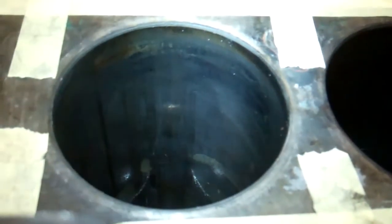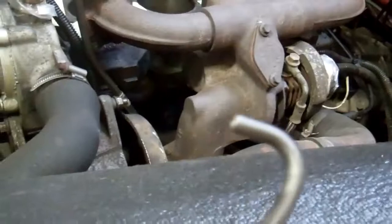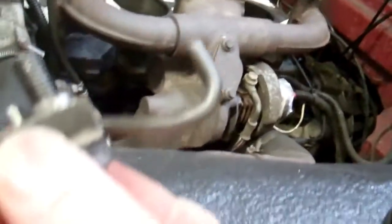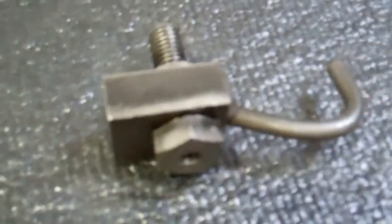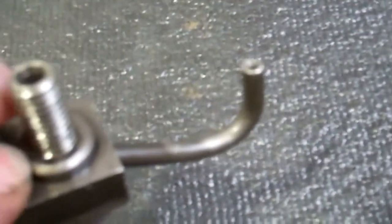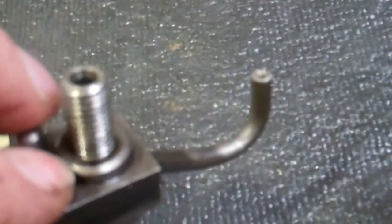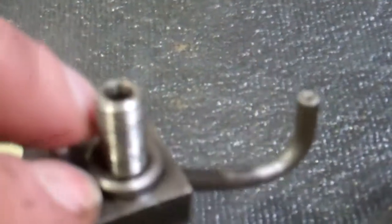So we're going to replace the piston and see if we can glaze bust — that's what we're going to do in this little video, show you how to glaze bust. I've got one other little bit to show you that's of some interest. This is a 300 TDI engine, and this is an interesting little thing on it — this could be another reason why it picked up on one side. This sits underneath the piston and oil travels through there and squirts up onto that area we've just shown you.